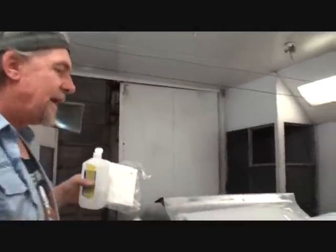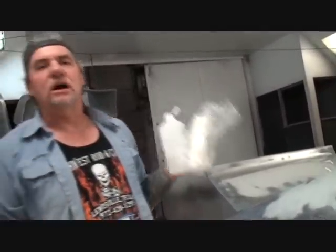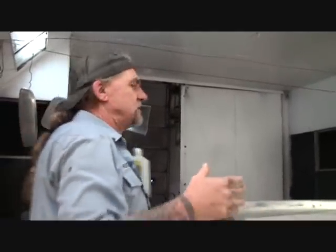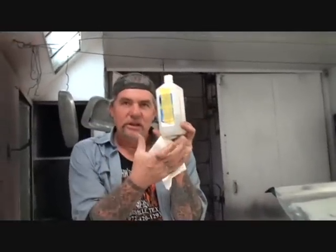This is epoxy primer. I sealed the car after I stripped it to bare metal to seal it. After a couple of years of doing this, we've come back with a DA with 180 or 220 and sanded it down for our filler primer, which is 2K. What you want to do to prep it for primer after two or three years — what we have right here in the bottle is rubbing alcohol. Plain and simple.